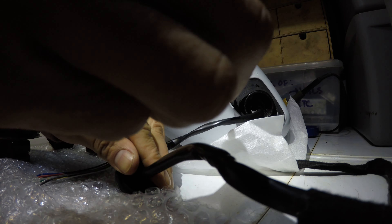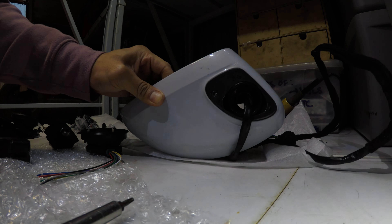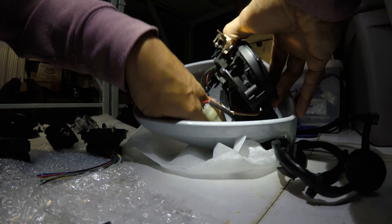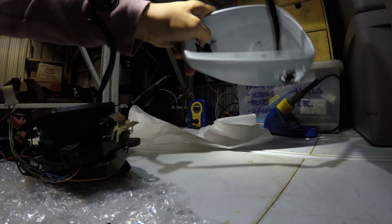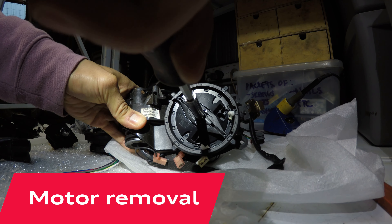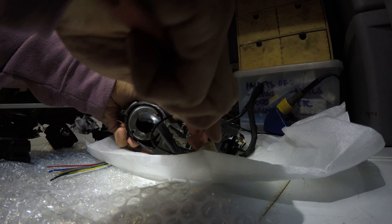To complete removing the wiring, there's the wing mirror indicator plug hiding behind the motor mount bracket. You'll need to remove a few T10 Torx screws, then you can reach in and unplug the indicator. Once that's unplugged, remove the bracket and wiring loom from the mirror cap. Removing the original motor is quite easy — there's one long Torx screw in the middle, then you just need to pry the motor out with a large flat head screwdriver or a very strong plastic pry tool.